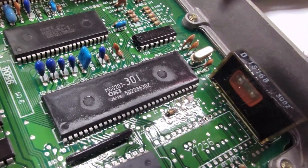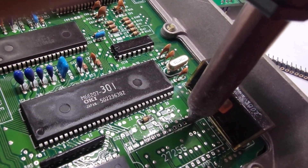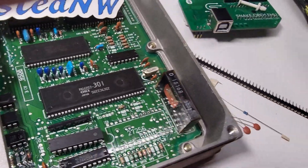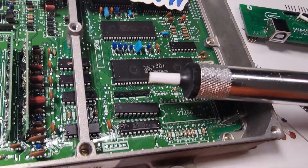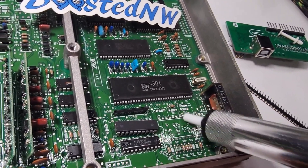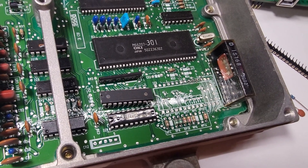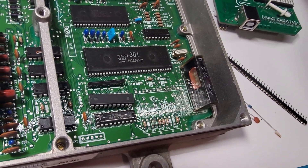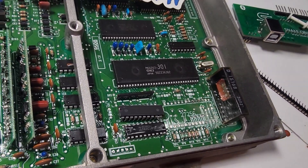It's as easy as that. But if you're not doing a lot of these like we do, it's not really worth it because this tool is three to four hundred dollars. Years ago we did just use the cheap ones, but it takes a lot more time and patience. You don't want to heat up the traces too much — you can damage the board, lift traces or pads, and then the board will need repair because you'll no longer have a spot to solder to.